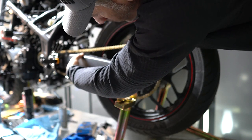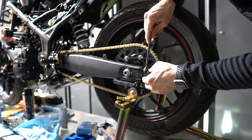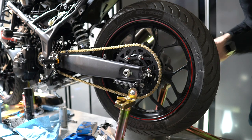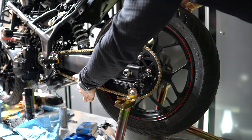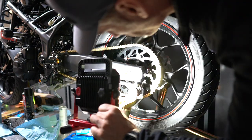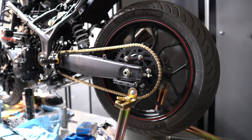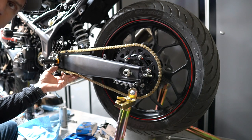We're getting a little closer — I think this might be a bit too tight, so just one minor last adjustment, maybe just a quarter turn. Now this is more like it. We'll make sure the tensioner has the same distance on both sides. I think we're okay for the adjustment — I'm going to secure this in place so it doesn't move. I have the slack I'm looking for in the chain.